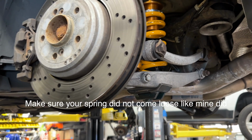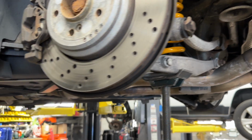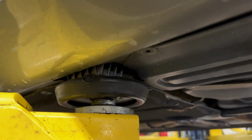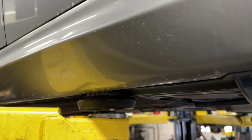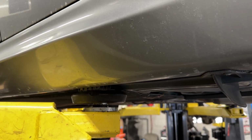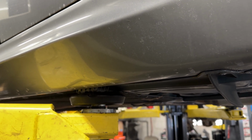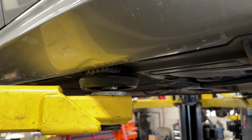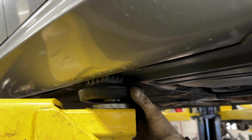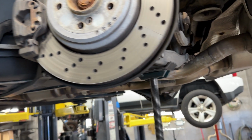So when you're preloading the suspension on the arm, let's say you are on a jack stand, you want to see it lift very slightly here. And then once it lifts very slightly there, you'll know that you're preloaded. You may not be able to visibly tell, but you can tell that it's off the lift because all of the weight is off of it. You can actually just jiggle this on. Yep. It's a little scary, but just be careful.